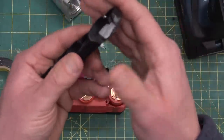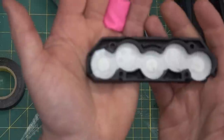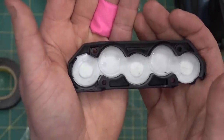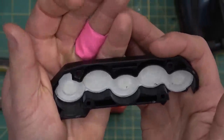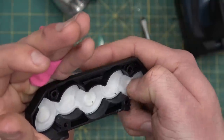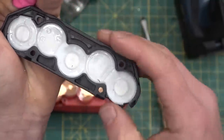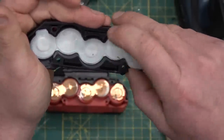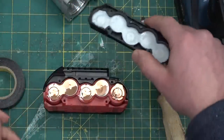Now the port side platen, this is the one that cracked. Not much meat there. There's none where it cracked, of course, because it's all gone. We've got glass fiber reinforced nylon, FR, which is fire retardant. It's got some bromine or something in there, some kind of compound, and something else. What's TPE? So some butylene. Never seen the white TPE. But this had no adhesive. And when she came off, there was all kinds of crinkling and like tinfoil sound and stuff.